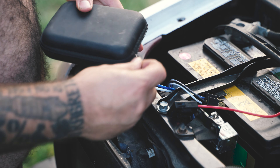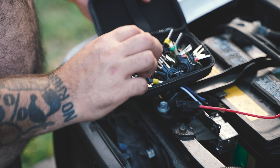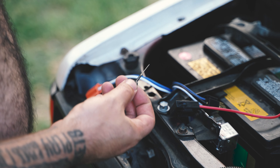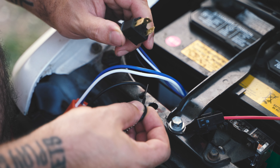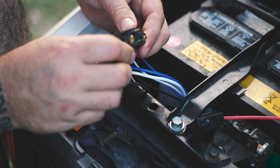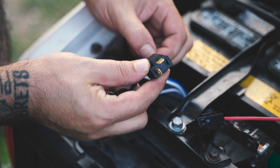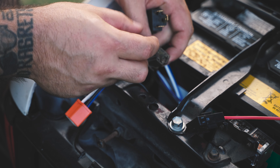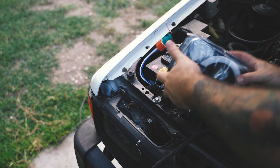I'll link this tool down below — it was about 20 bucks and it's come in handy quite a few times. It's called a de-pinning harness tool and it comes with all types of different picks. I'm just going to use a regular flat one — you could also use a tiny screwdriver. There's a little beveled tab on the inside; you push it in and you can pull the wire out. So in essence, I just found where the two hots are — left and right on the stock connector — de-pinned and rearranged the black and white pins, and now they work.